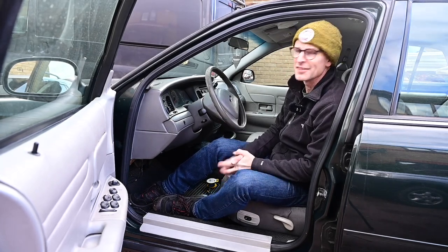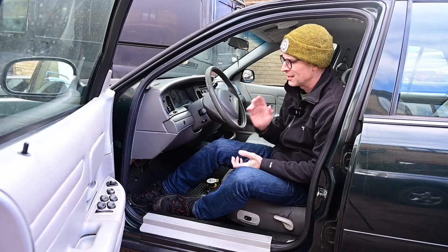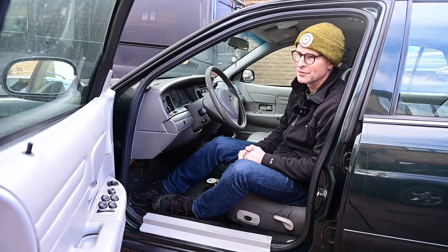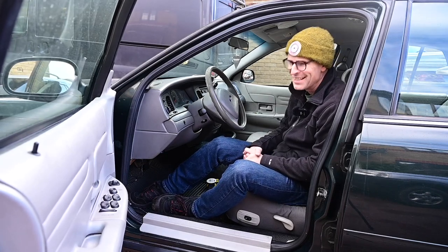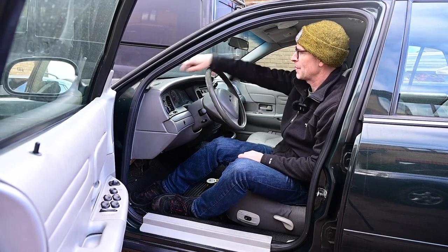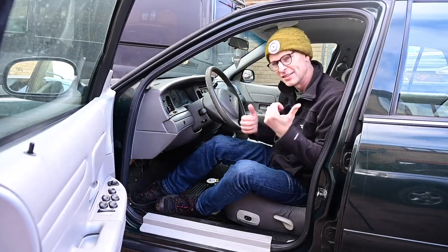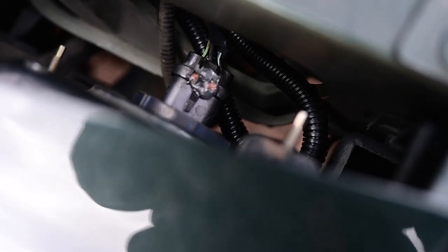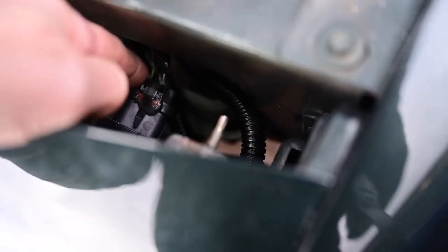I've been trying to do this for ages. As you know the original auto-electrician never showed up so I did all the tail lights myself which was frankly terrifying. But I couldn't make the fog light system work. James from Advanced In Car Solutions came around and he knocked it out of the park. It was a freezing cold afternoon, about one degree centigrade. I just took one picture of him out the window and let him get on with it because it was painfully cold and getting dark. But he did a great job. In the end he took a power feed from the headlights in the front of the car. I'd already run a power line from the dashboard to the back of the car taking the back seat out. Then he connected it all up as I'd hoped. The only thing that looks non-standard is that bit of silicone because the catch had been broken at some point in the car's history. Now that won't fall out. You can't even tell where it goes through the loom and into the bulkhead.